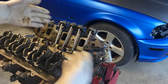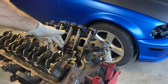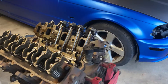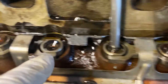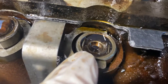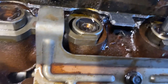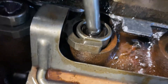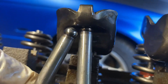Go forth and complete the mission all the way down. Make sure you have the push rod inside where the lifter goes. Let's actually take a look at what's happening here. The push rod goes down inside the lifter — you see where there's a little round hole inside there, kind of pushed down in. That's exactly where this piece, the rod, is going to sit right down in there and rotate. The rod also goes on the bottom of the lifter piece here.